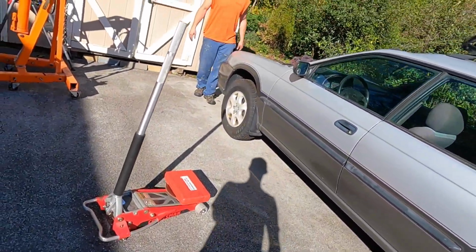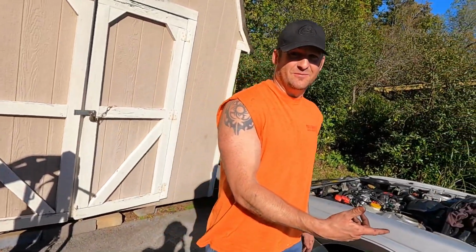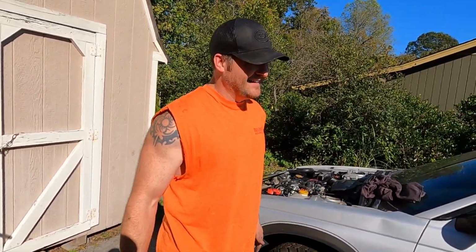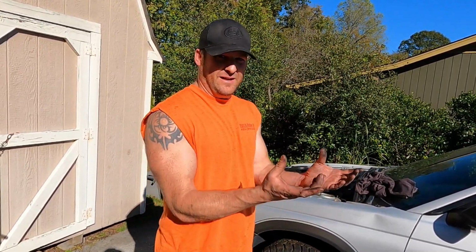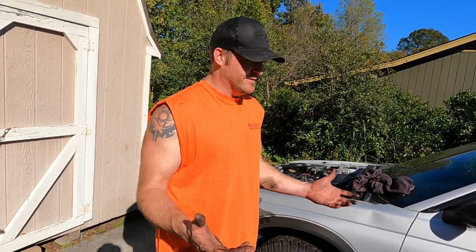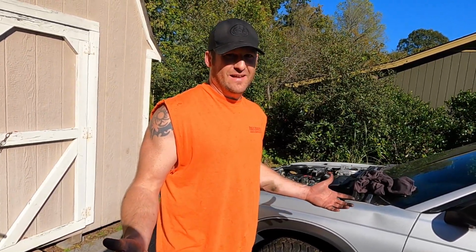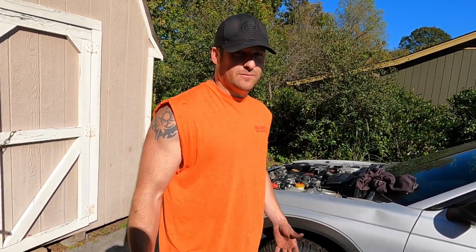It definitely has an exhaust leak. Oh yeah, major exhaust leak. I know where it's at. In the center, if you look at it, I was going to fix it, and I was like, man, it's not even worth taking it out. But in the center, they put two clamps on it, tried to wrap it with a piece of metal, and then it looks like they welded it with a stick welder. So it definitely has an exhaust leak. But that's okay, I'm fine with that. I just wanted to make sure the motor was going to run.